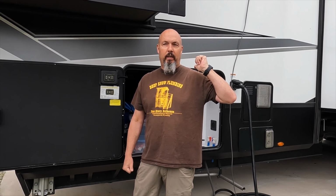However, there's one thing that it can be, and it's the rear sensor. There's two sensors in a 6-point level system. One is in the front, one is in the rear. It's a little box about this big that tells the system if it's level or not. So I'm gonna have to crawl under tonight or today, get the underbelly pulled down and see if it's the sensor or if it's just out of position. There could be a few things going on here.